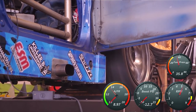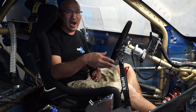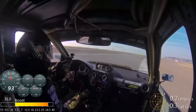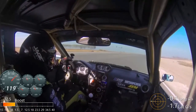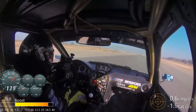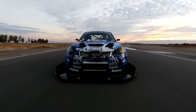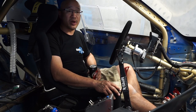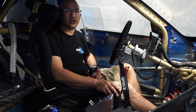There are commanded base duty cycles we set up — the closer you are inherently to what the car actually requires in base duty cycles to hit your target boost levels, the better. We have our boost target set up by throttle position and RPM to make the car as progressive as possible in and out of power through corners. On other systems, you have to be dead-on with base duty cycles to avoid overshooting, undershooting, or oscillating. The AEM system and solenoid are really quick-responding and intuitive.